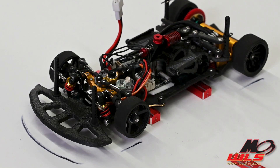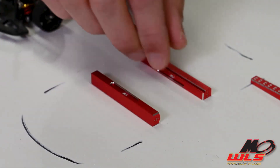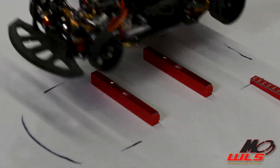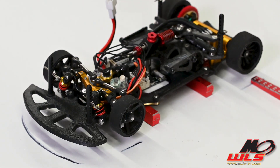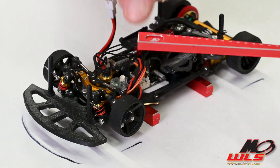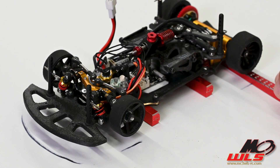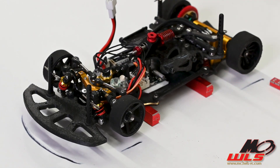Here's something a little different about our system compared to others. At the rear of the chassis, I can't use the droop block at the standard height because it's too low. The great thing is you can flip these blocks to both sides — I've raised it from 6 millimeters to 8 millimeters, which gets it a little higher off the ground. There are additional measurements on the side that you'll now use to measure the rear droop.